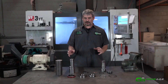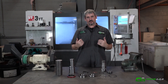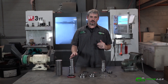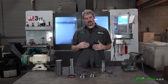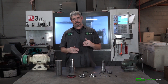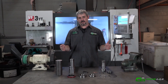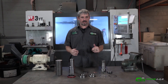When you're looking online to piece this together for your kit, you'll want the spindles and then a bearing kit. We've also got a deal where you can send in your 14-bolt hubs and we'll bore them. There are actually two different lengths of spindles on a 14-bolt, and we've made this spindle work with either one of those hub offsets. We'll bore the hub and fit it for the new bearings and snap ring grooves. Or, we'll have pre-bored, shot-peened hubs ready to go on the shelf for sale on the website. If we're building a rear end as a roller kit or a full turnkey rear end, we'll send you a drawing of widths and everything else, you tell us what you need, we approve it, and then we can get the build done.